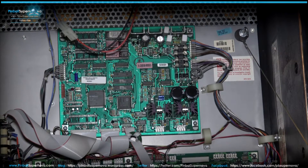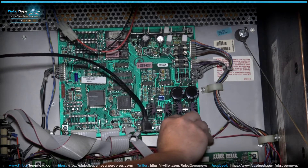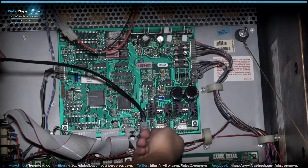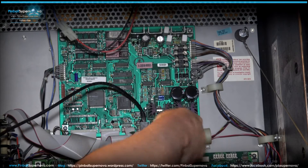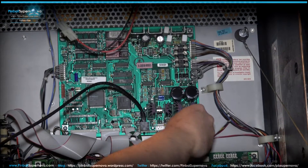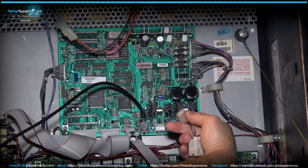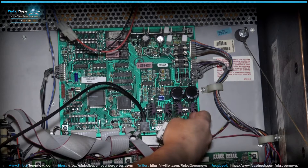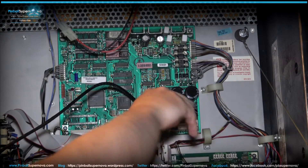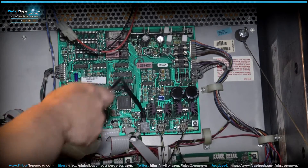Take it with your network cable going to the left and line it up, then push it on until it seats all the way. Take the two cables you removed earlier and plug them onto the male pins on this daughter board. Note that they're pinned — I tried them the wrong way — so that one goes there and the other goes here. You can't put them on backwards since they're keyed to fit only one way.